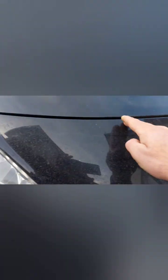So it's all broken. I got another one, a second-hand replacement from the breakers, so we're going to attempt replacing the bumper. I know there are a few screws on the top, a couple of bolts underneath, and two bolts on each side underneath the side light. You need to get your hand behind this liner, and to remove the liner there are some panel clips, one on the bottom there, and some inside within the wheel arch.